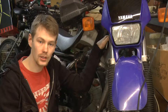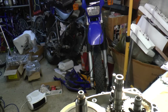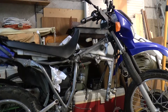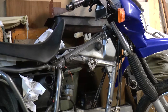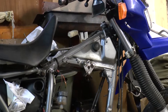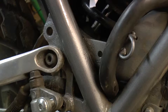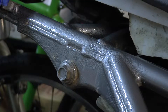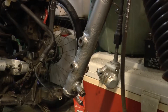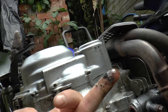Now that I've stripped the engine, I've discovered nothing's particularly worn on the inside, so the engine itself isn't generating the metal fragments — it's come from somewhere else. The XT600 uses a dry sump oil system, which means it has an oil tank separate from the engine. In this case, the oil tank formed part of the frame just behind the headstock. When I looked closer at the frame, I noticed strange patches in the paintwork. I think this frame has been resprayed, and one of the first things you do when respraying a frame is shot blast the corrosion. What I think happened is that when the frame was stripped, some of the shot blast media got inside the oil tank. When the bike was reassembled, the blast media was passed into the engine, and that's what I've been finding.